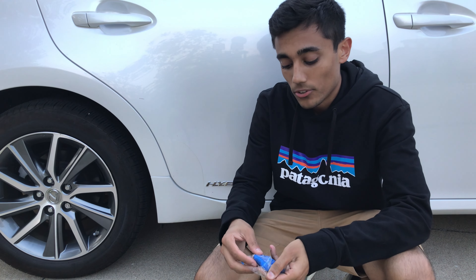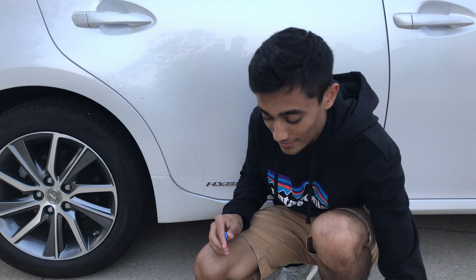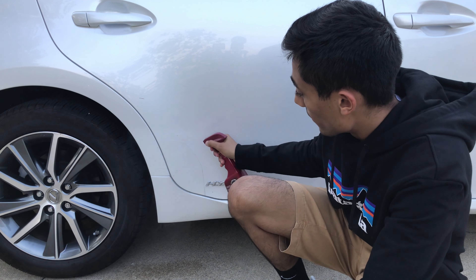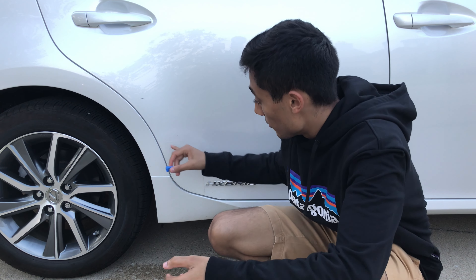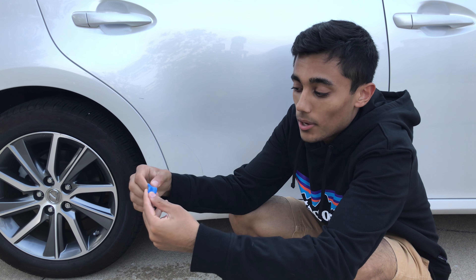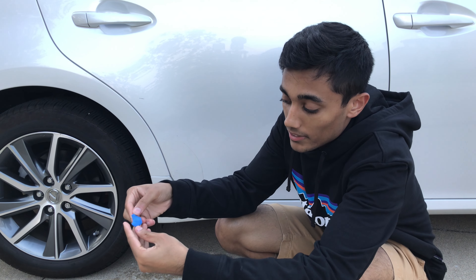Now, if you know about clay bars you can just tune out — you already know what to do. But if you don't, it's pretty simple. All you want to do is tear off a decent-sized piece of the clay bar. And in case you're wondering, no, you cannot just go and get your little sister or daughter's Play-Doh clay — it's not going to work. Automotive clay is different. What we're going to do is knead the clay and make it wet, and we're just going to spray all around the border here too. The key is to make sure it's wet at all times. You don't want the clay drying out and you don't want anything around here drying out, because that's when the clay starts digging into your paint and scratching. And every so often, take the clay back and knead it again, so that whatever debris are getting pulled out don't stay and start scratching. You just want to pull it out, hide it into the clay, and get a new side.